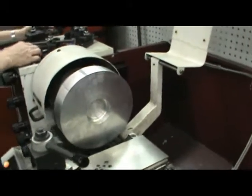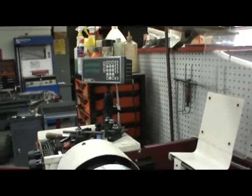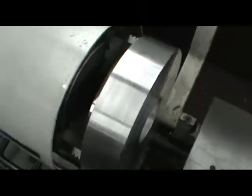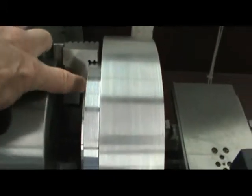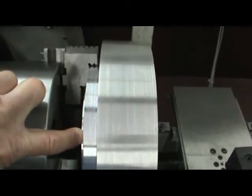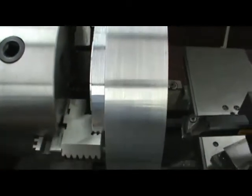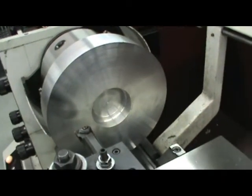We're across the street at a more precision lathe that has digital readout. Things will be able to be done a lot more precisely with what he has. Now he's cleaned up the back of this so that it'll fit his machine. The jaws here hit this ledge that I left as big as I could, so he had to take about an eighth of an inch or so off of that. That allows him to grip this, and he's trued it up so that it works on his machine properly and everything's nice and flat.